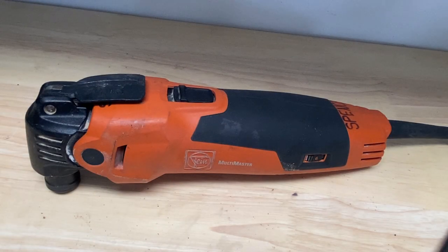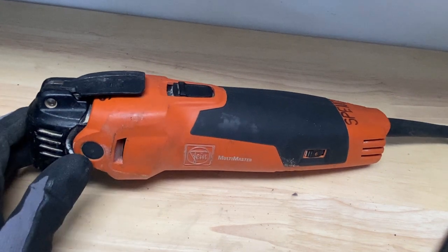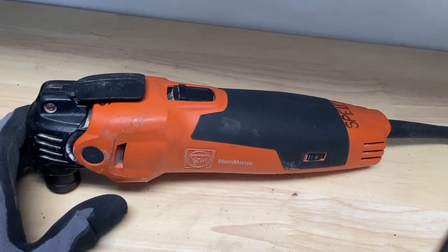All right, so the housing's back together. I'm going to let the tool sit for about 24 hours so that the glue, the epoxy, has time to cure. The directions say that it has a set time in about 4 to 6 hours, and it cures in 15 to 24 hours, depending on the temperature. So it says allow 4 to 6 hours before handling whatever it is you're gluing. And then it says minimum 15 hours before putting the object back in use. So I'm just going to go ahead and wait 24 hours. I'm sure it'll be nice and solid then.